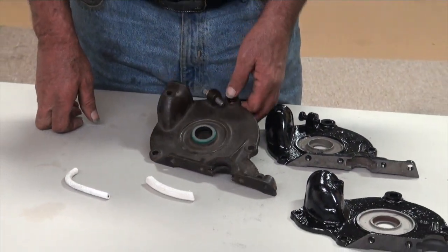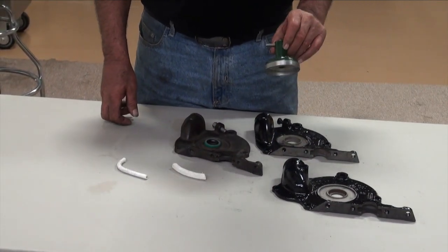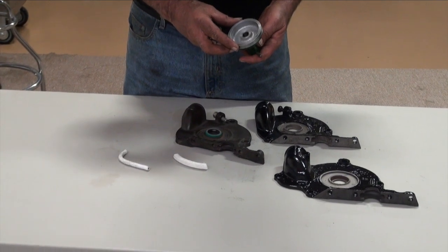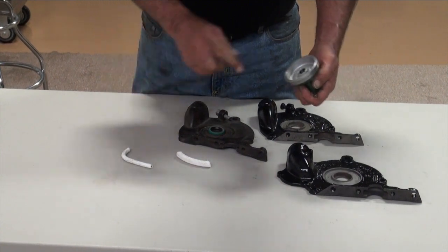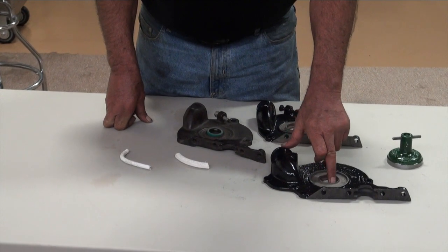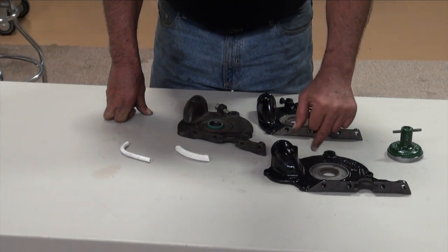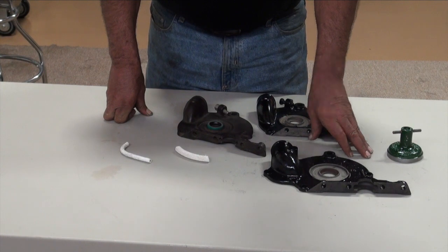It's your choices — it's your car, it's your engine. Another tool I have here is a KR Wilson alignment tool. When we get that front plate on the engine, we want to make sure that it slides over the cam and the front plate is centered on that cam. If you put it on without any way of centering it, it'll be off-center. And if you're running a timer rather than a distributor, it's going to give you skips — it'll wear out the timer, wear out the roller or brushes quicker, and cause ignition problems later down the road.